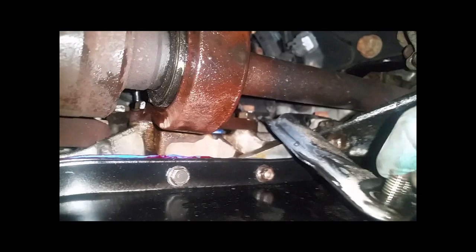Alright, lining up the exhaust with the studs — the studs are in the way, gotta push them back so we can get it higher. These are the 12mm nuts down here and the 14mm go up there. Two 12s here — they're still grimy, I didn't clean those, but over time they should dry off.